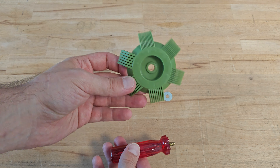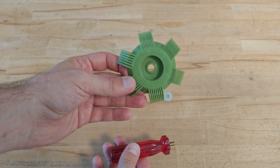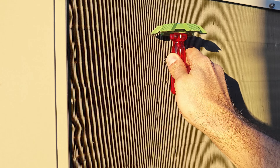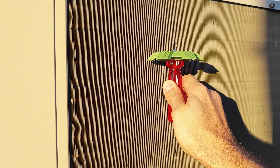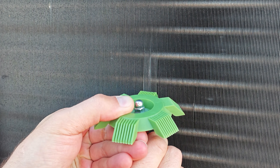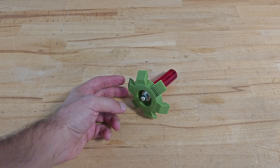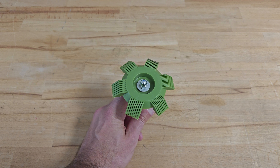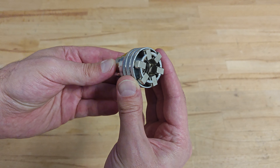Let's continue with the next product: the straightening comb for radiator or condenser fins. There are two ways to attach it to the handle — this way, or the opposite — or eventually you can use it without a handle; it all depends on your preferences. For a price of about 2 euros, it's doing what's advertised, but only if the damage is light. Don't expect it to help you if your radiator or condenser fins are heavily deformed. One tool can help you service a few different types of radiators or condensers with different spacing between the fins.